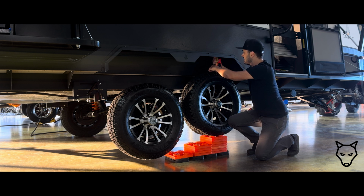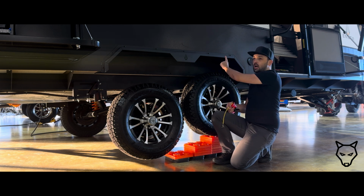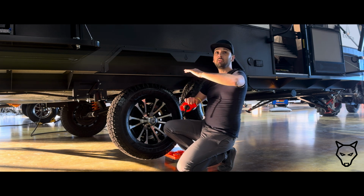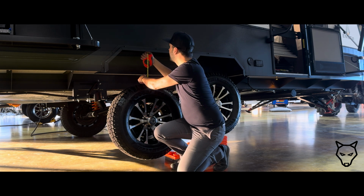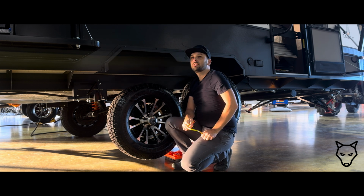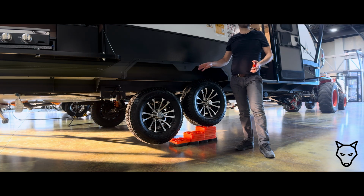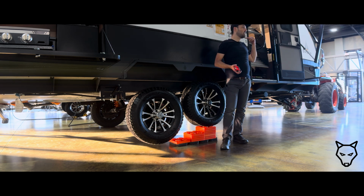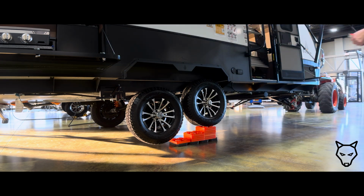Okay, from the edge of the lug to the bottom, that's exactly 7 inches. For context, it was 9 1/4. So up travel has been 2 1/4 inches, and that is already the total travel of the Micro Mini FLX. And then in the down travel, we have just about 12 inches on the dot. So 7, 8, 9, 10, 11, 12, 5 inches total. So this is almost exactly twice the suspension travel of the Micro Mini FLX, which is, dollar to dollar, a direct competitor to this, and yet twice the suspension. I'm surprised. Like I said, I knew it would be good, but I didn't think it would be that good.